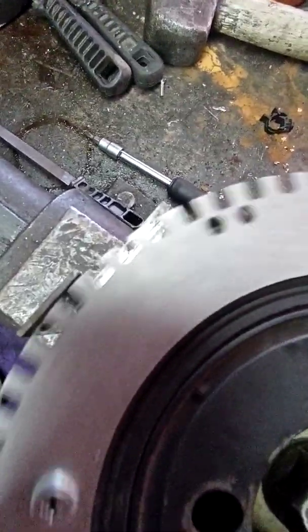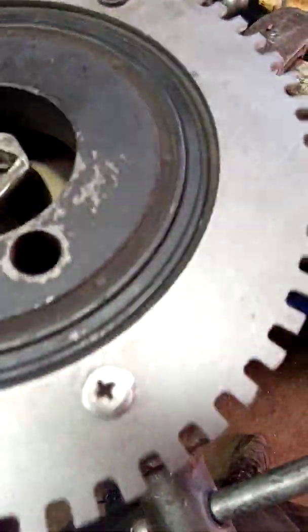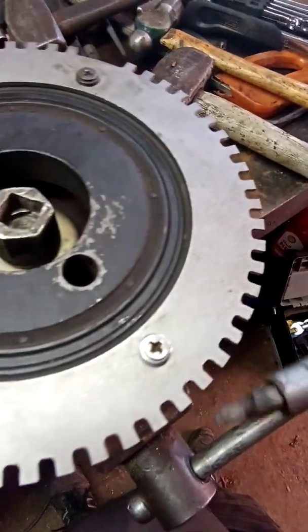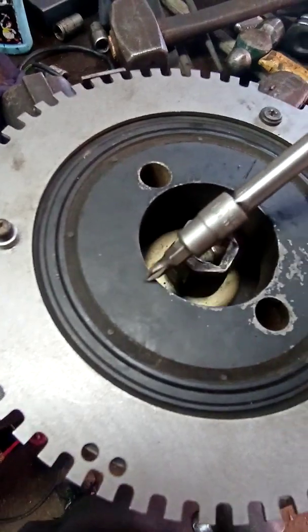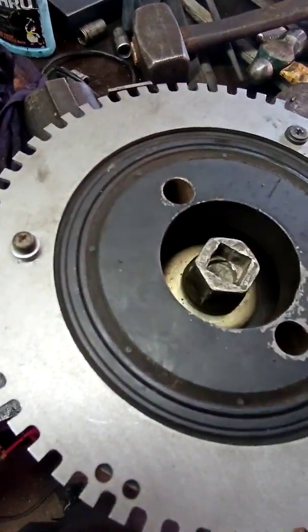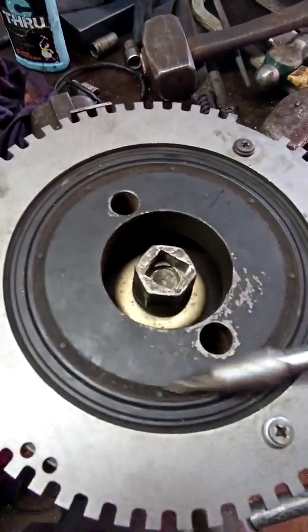No machining, no balancing, none of that fancy stuff. The reason I'm using these weird looking screws is these are not going to be on the final car — they'll throw the weight off. It's important that you always use the same fastener. Preferably it's better to weld it. I'm running my harmonic damper right about here, and ideally you want it fastened on the inner side of the crank pulley, not the outer rubber section which flexes and causes interference.